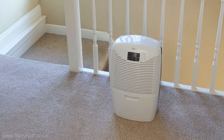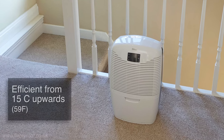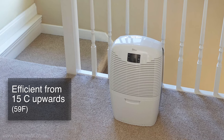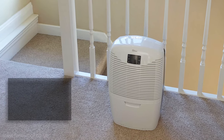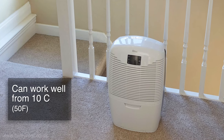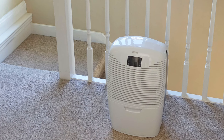Because this is a compressor-based dehumidifier it will work best in a heated home, but as long as you can heat your house up to 15 degrees centigrade, a dehumidifier with this low power consumption rating should outperform most alternatives such as a desiccant — although the manufacturer states it still remains effective as low as 10 degrees centigrade. Impressive stuff.